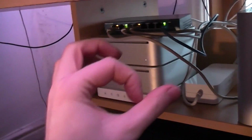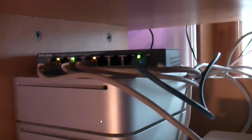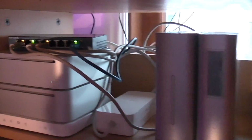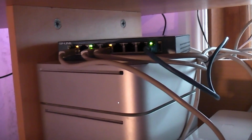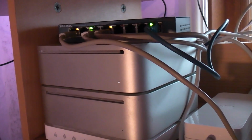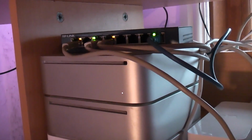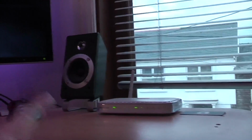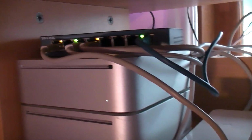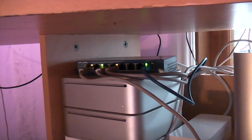This is going to be mounted on the side of my desk here, and all the cables are going to run under the top there. All the Ethernet cables are going to be tied. Really nice, just one wad of Ethernet cables. And also I'm going to color code them all. So the two servers will be on two short 0.5 meter red cables. The two computers will be on yellow cables, I believe, or blue cables or something. And the modem and the router will be on a different color cable, so it'll all be color coordinated, very nice, and it technically gives me 2 ports free.